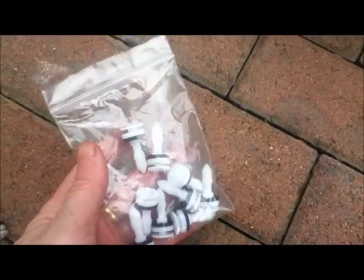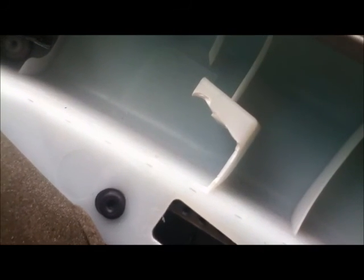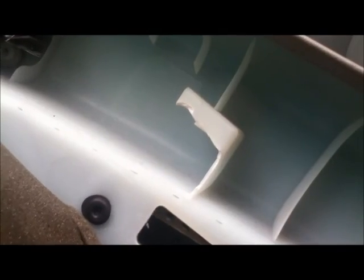One of these lugs is missing — it's obviously fallen out and come out the bottom of the car. I've looked all in the bottom of here and it isn't there, so I've actually anticipated this and went to eBay and bought a packet. They're only a few pounds and you can do both doors with this kit. Three out of the four mounting points are just broken, and in this one I can actually relocate the lug which is very helpful because it tells me how it goes together. The one up the top is quite smashed up, but the one in the middle is completely missing, so I'm going to have to do a massive rebuild on that.